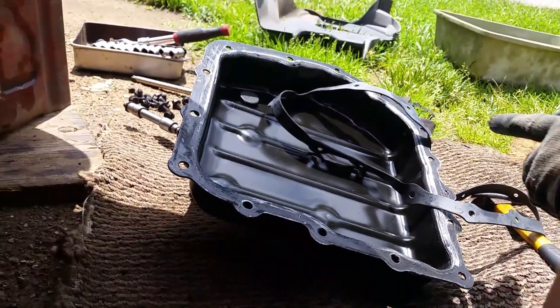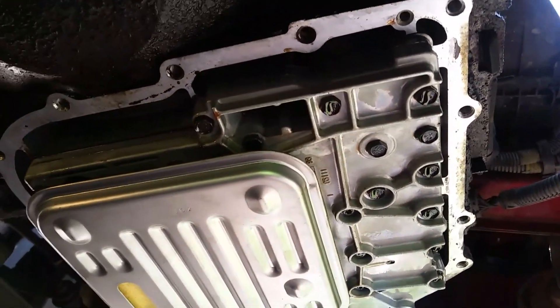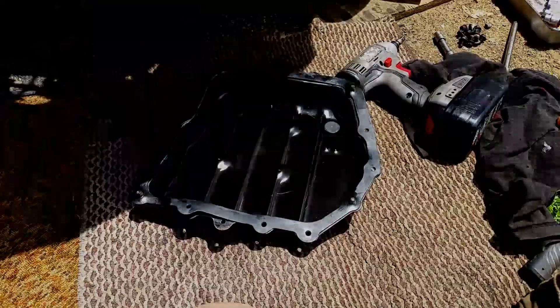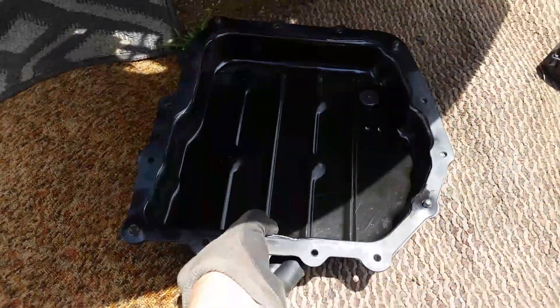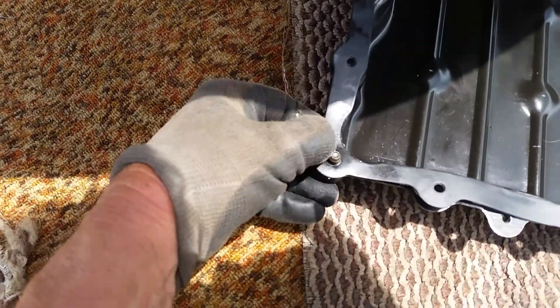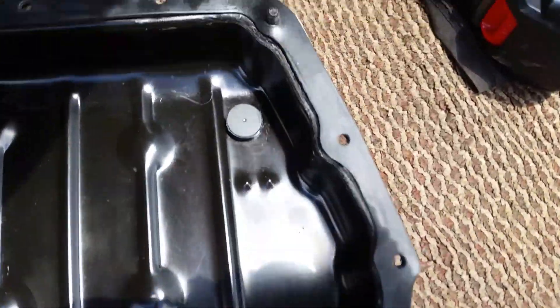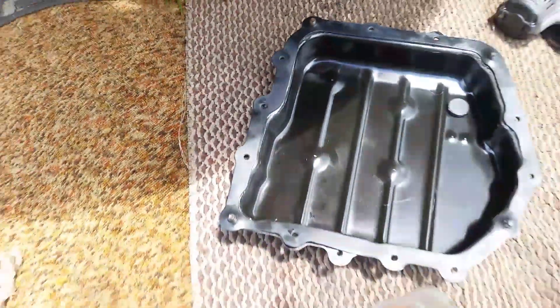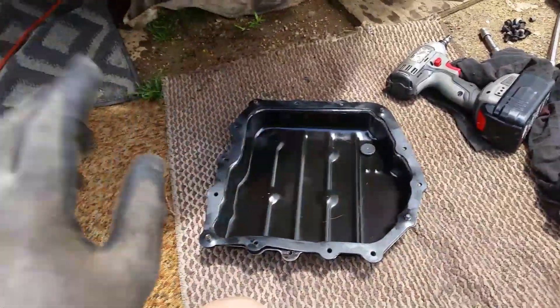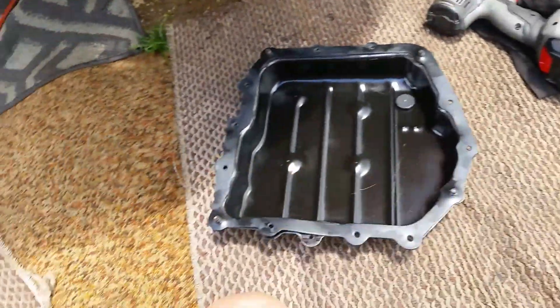I'm going to put this oil pan on, start these bolts by hand one at a time. Maintenance is always cheap if you can do it yourself. Here's a quick tip: I've got the gasket in the pan with four bolts — one, two, three, four — the holes aren't very big so it'll actually hold the bolts in. I can turn it upside down and the gasket won't fall off. Now, some of you might say put some silicone on there — don't do it. If you put silicone on this gasket and tighten it down, it'll squish out and the gasket will tend to move. Keep it as clean from oil as you can.